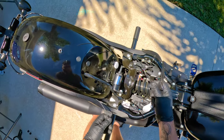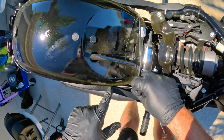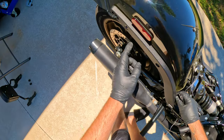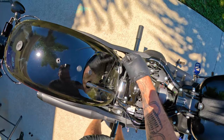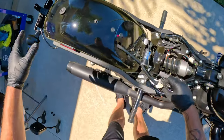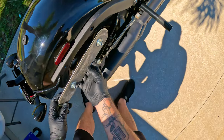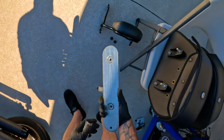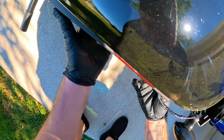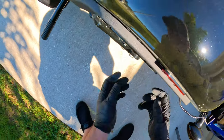You can see the wires are kind of pinched here — they run through this bracket. Once you loosen where the bags were mounted, this will lift up. All the zip ties are disconnected, so now we can take it all off. Before you try to force the fender up, there are little brackets that hold it in place — you need to remove those first.